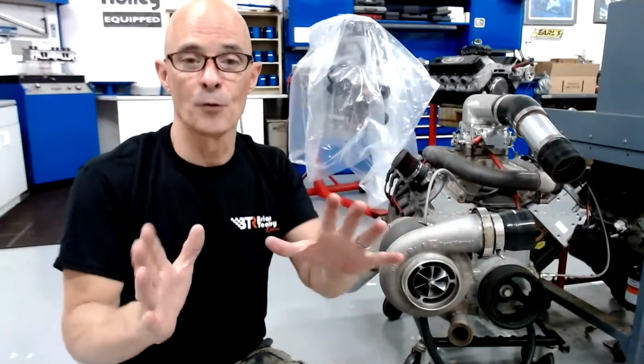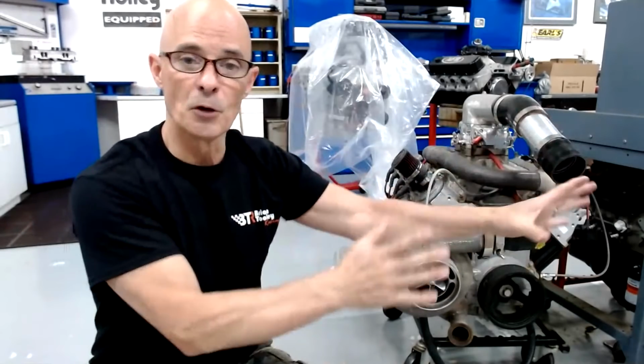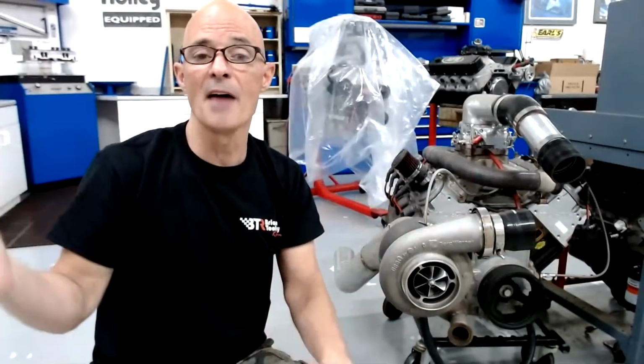What you can do is, if you don't have a good turbo and you have lots of back pressure, or you don't have enough octane to where you have to limit the timing, or you don't have an intercooler, all of those things take away from the formula. So you would be making less than the formula, and if you improve those things, you can now get up to the formula. But going beyond that, on our 300 horsepower motor, going beyond 20 horsepower per pound of boost gets more and more difficult.